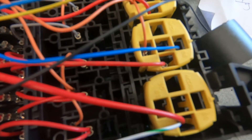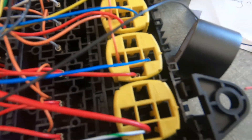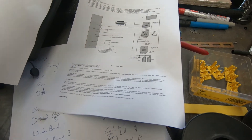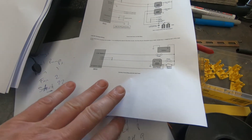One thing to note is this EFI relay here - it provides voltage to the positive side of the relay, so that same output from here becomes the input for here, and that just prevents back-feeds on the auxiliary channels. There is information in PC Link on the power grounding - if you pop into PC Link you can get all the different ways of wiring it. I'll be using the Thunder, so I'm going to wire it like this diagram - that one there for the Thunder.